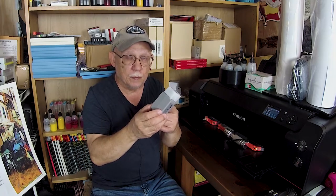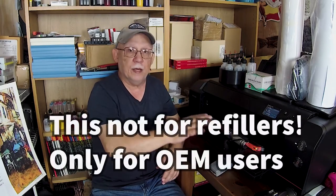Print until it is empty — that's when you want to remove the cartridge. Otherwise, if you're not refilling, you would be throwing away fairly expensive ink. This gives you the luxury to go until it's declared empty, not beyond that. When you remove it and weigh it, it will weigh 32 to 33 grams — that's about dry weight. You can't really shake it to detect remaining ink because it's very hard to distinguish. What you hear is the chip floating around. It's best to use a gram scale — it has to weigh 32 to 32.5 or 33 grams to confirm it's empty.